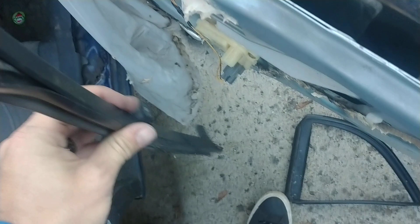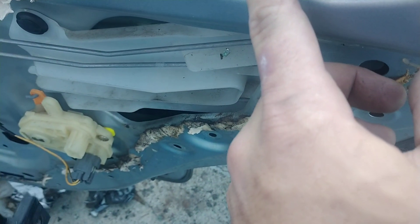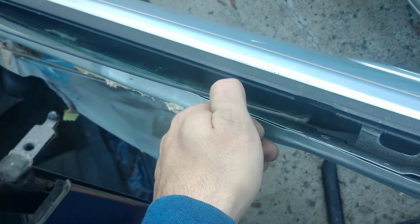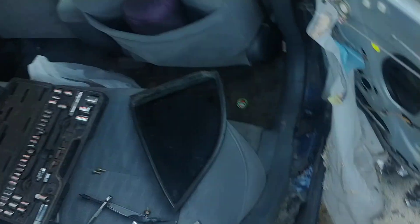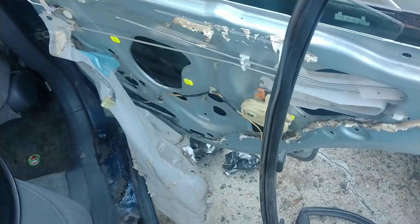Make sure when you put this in, your window channel is still in there when it goes down and hasn't moved. Once you get it down enough, align these two pieces of channel back up and start seating them back into the window bracket and into the door bracket here. Then put your bolt back in at the bottom, make sure it's all nicely aligned up top, and put the bolt in at the top. Put that silver screw back in. Do verify that you've aligned the window into the channel correctly before going further — turn the key and do the window operation. Note the window will not work without the switch plugged back into the door. Once you've verified the window still goes up and down as it's supposed to, basically reverse the order for everything else.